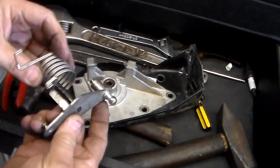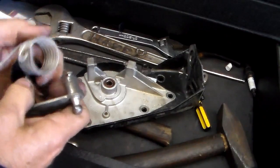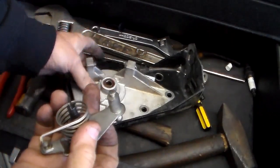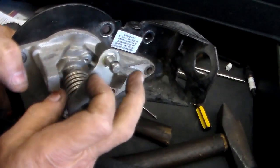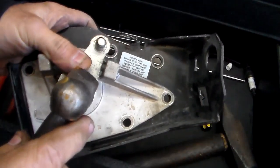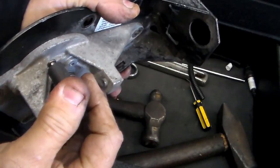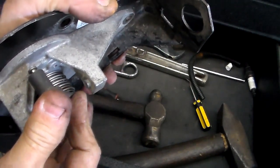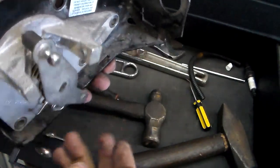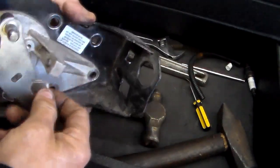Get all this stuff back together where it's supposed to go - push it on first, that's just a spacer, probably to hold the spring. It's a tight fit and will definitely have to be tapped in. That solved my problem - I mean I've got the slightest bit of play now, it's very very tight. Of course I forgot to preload my spring, so I'll have to tap it back out.